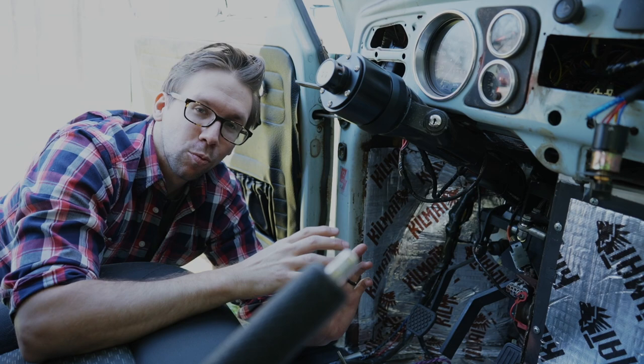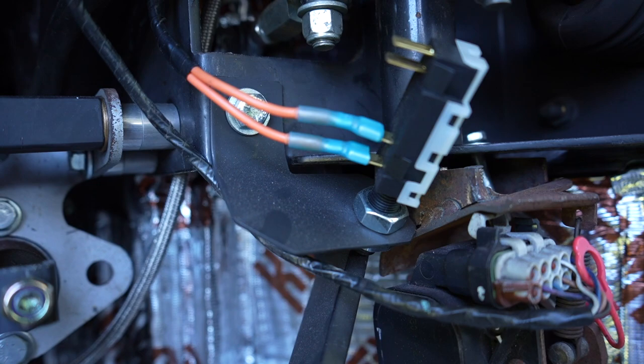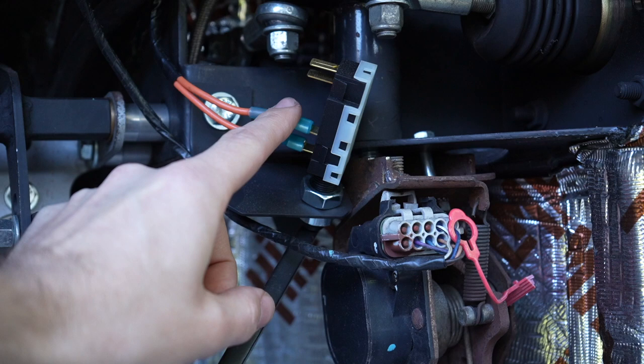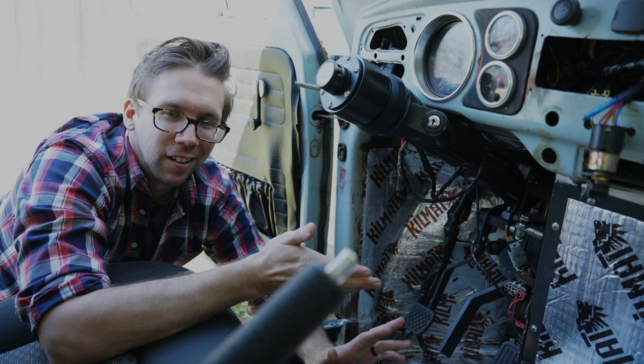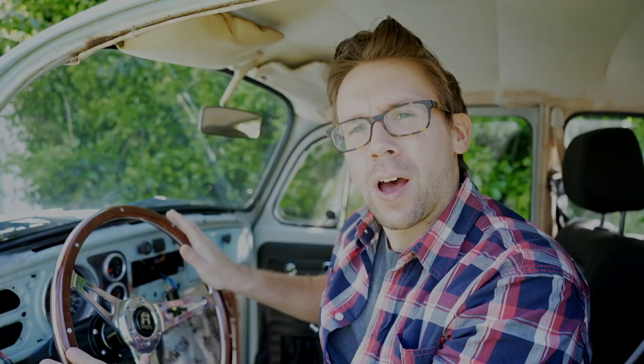The wiring for the swap is super easy. If you're retrofitting from a pressure switch style activation, all you have to do is run the wires from under the hood into the cabin and connect them to the two pins closest to the brake pedal. If you've got a torque converter that you need to unlock, you'll have to run power from your positive side jumped over to one of the terminals and connect your torque converter lockup wire to the other. I like to confirm the signal is actually making it down to the transmission using a meter, but you can kind of tell when you press the brake pedal if it's unlocking or not. Test it out because you don't want to lose a torque converter 3,000 miles down the road because you wired it backwards.